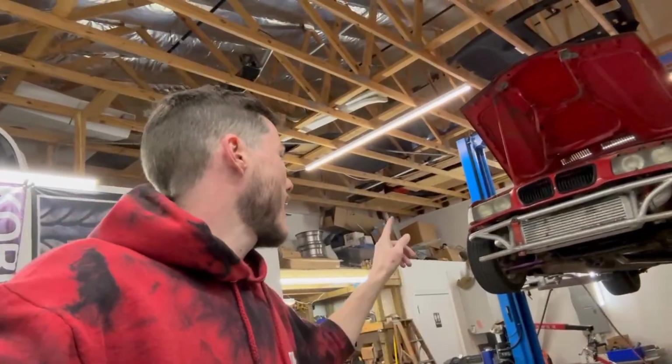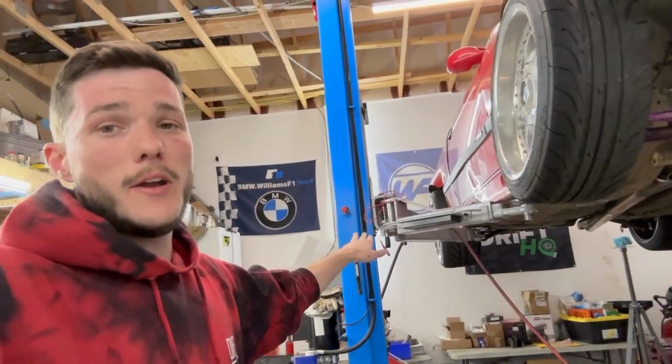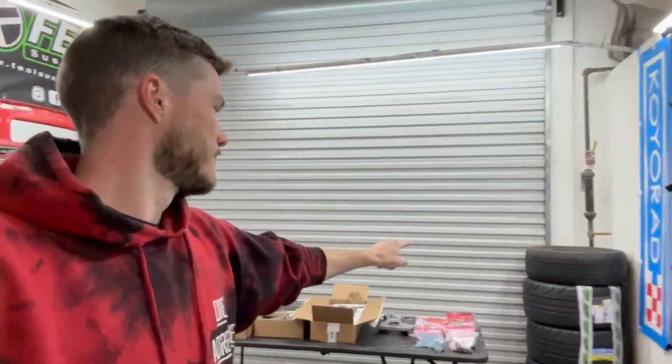I want to go ahead and get the 8K springs out of the front. I want to put some 12Ks that I have on the shelf in, which is going to effectively tighten up the front and distribute a lot more of the weight onto the rear. Another thing I did was put on those 265 Kendas I have rather than those, honest to God, not all that great 255, what are those? 651s, Acceleras.